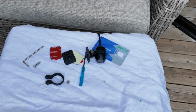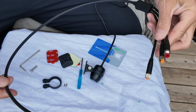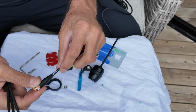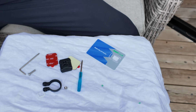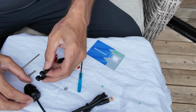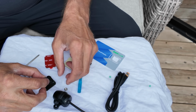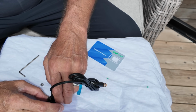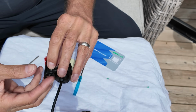Okay, cameras. Now, really simple. I'm only going to fit the front one today. That's the harness. That plugs in. If you look at your camera, it'll say camera back. Okay, and the other camera on the cable will say camera front. So these are really easy. I'll quickly show you. That's got a little ring around it that goes into this groove here. Get the little bolt and the nut and hold that in place. Buzz the nut through. And on this side, it's captive. Another piece of clever engineering by Chigee.